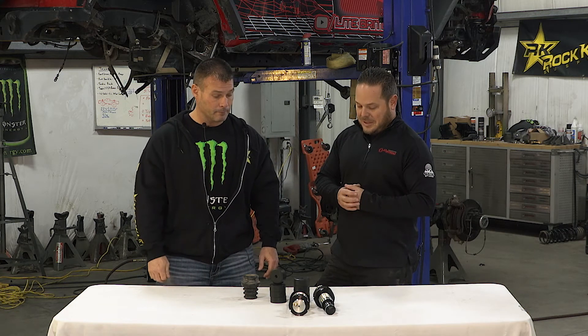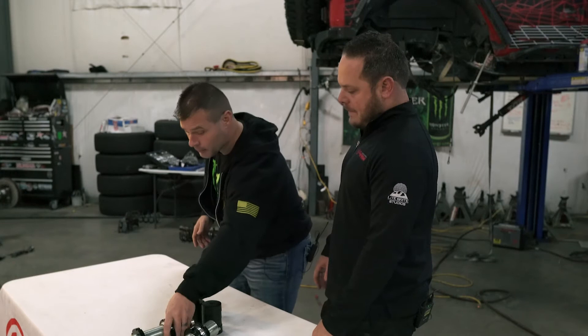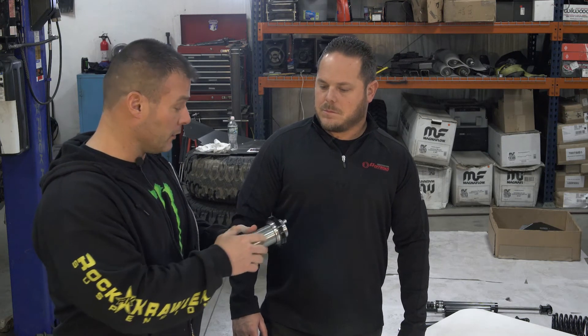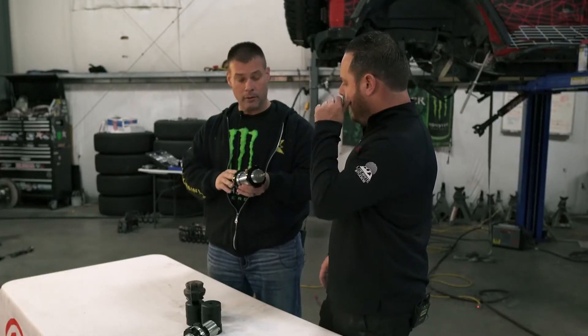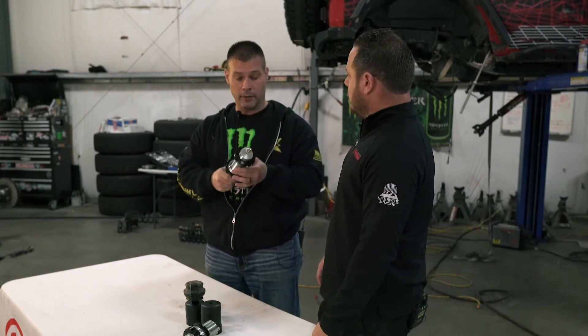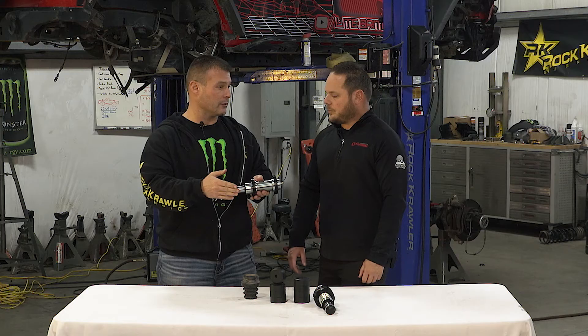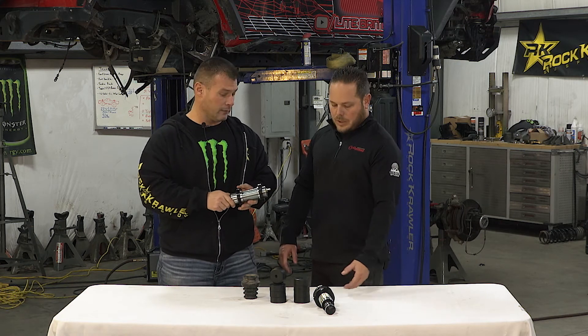There's not much more to know about bump stops beyond proper setup. It's really about the degree of performance. These air bumps come with extra features — adjustability built in, not only setting the bottom stop but also adjusting the threaded body to move it up and down. So if you're not perfect, you have some forgiveness. All the major manufacturers — Fox, King, Radflow — make these adjustable body bump stops to help you dial it in slightly afterwards if you're not perfect.